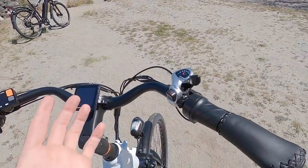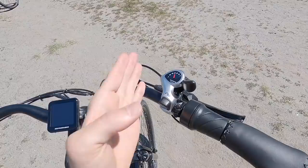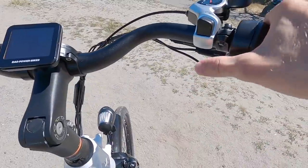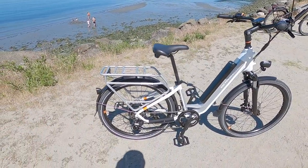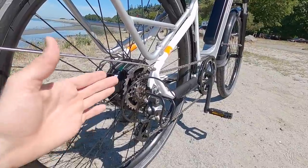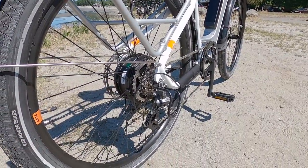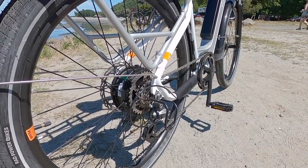The shifter is the same as before — it's got this button down here and a big knob up top. A lot of people like it because it's very visual with the different numbers, so you can very clearly tell what gear you're in. It's a little bit of a reach for me, but if you're wearing gloves it's very easy to make the right gear selection, versus small trigger shifters which can get tricky. Still got the DNP nickel-plated seven-speed freewheel — not a cassette, but this is a custom-made freewheel, 11 to 34 tooth, which is a really big range. That 34-tooth ring helps you get started climbing or carrying heavy cargo. Nickel-plated means it'll hold up better over time.